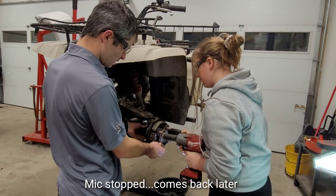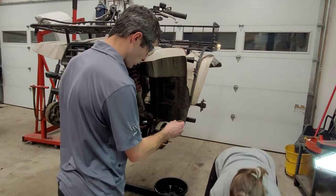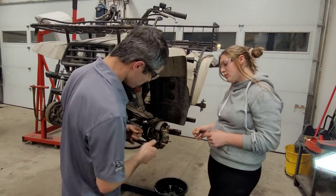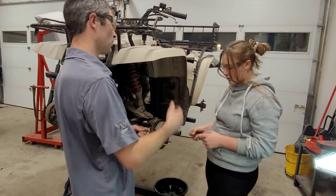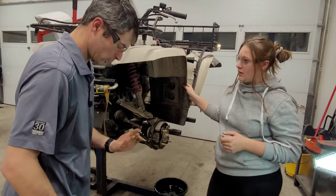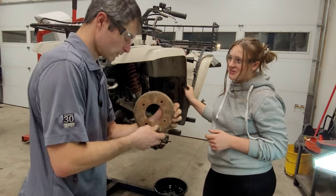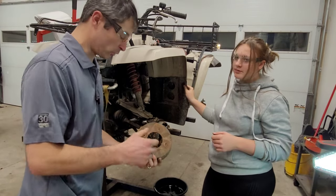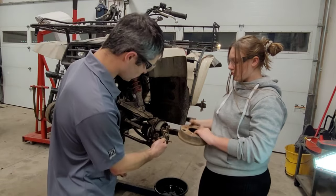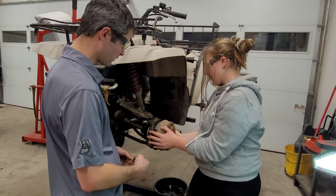You see how we've still got some slack there? We can drop the cotter pin right into that hole. There's also this little access hole — see, you need to pull this adjuster off and you can gain access to the adjusters through that little access hole. We can't quite get it on now probably because we've got way too much adjustment, so I'm going to turn these down. Now try that and see if it fits.